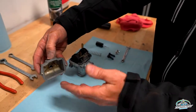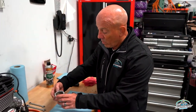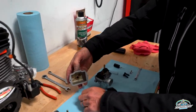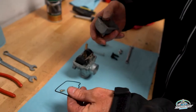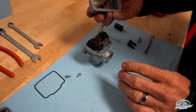This residue all has to come out. This carburetor may actually have to soak for a while in mineral spirits, or you can also use a carb cleaner. Carb cleaner is a little more caustic than brake cleaner, but carb cleaner will work much better — just be careful with it. You can remove the screws, and please keep in mind that there's also a gasket in here that probably will have to be replaced, as it's squashed in some corners from sitting so long.